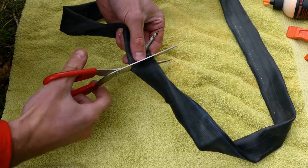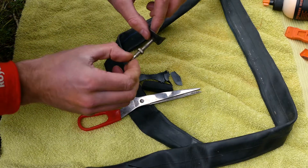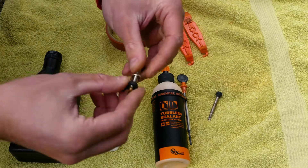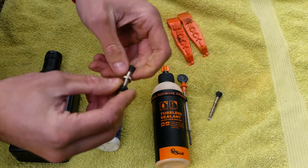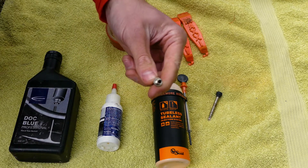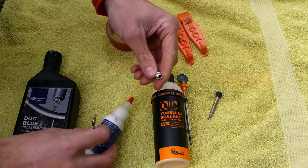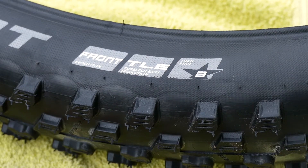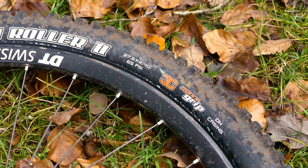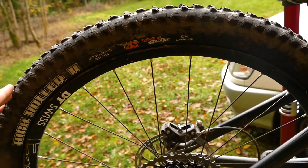You'll need some tubeless valves. If you don't have any tubeless valves, you can get away with just an old tube and cut out the valve from there — it's not as good, but it'll do. You'll also need a valve core remover: you put it on the valve and unscrew the valve core so you can remove it, giving you much better airflow through the valve to seat the tire. Of course you'll also need some tubeless tires. You can see on the side of these Schwalbe tires it says 'tubeless ready.' I've set up a lot of Maxxis tires as well which are not necessarily tubeless ready — these downhill tires, for example — but they set up just fine anyway.